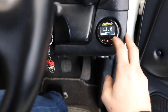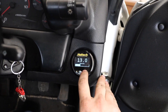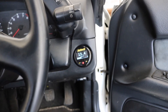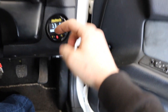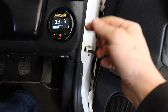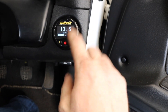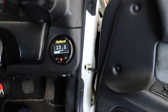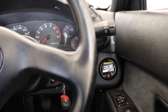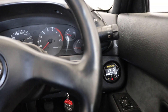This CAN gauge is really cool — anything the ECU reads I could set it up to read. Just flip through everything: you download the gauge art app on your phone and set it up however you want. Right now I just have AFR, but I could have AFR, boost, all the temperatures — I can set it up however I want. With the door closed the gauge has nice clearance right in my vision with no sun glare.